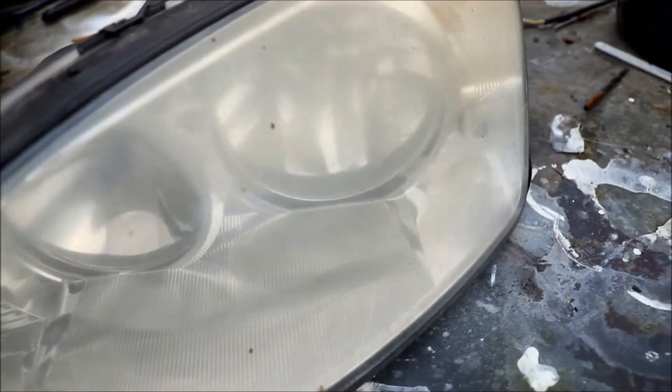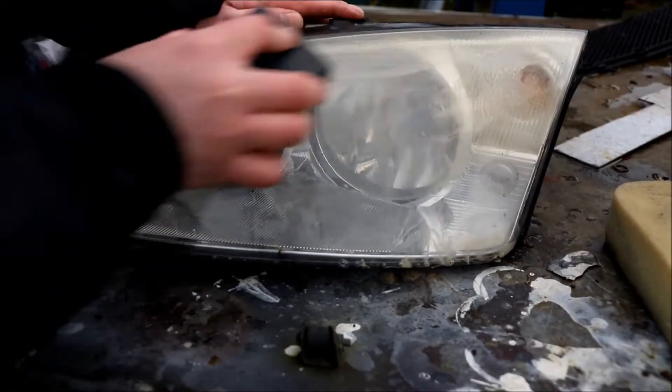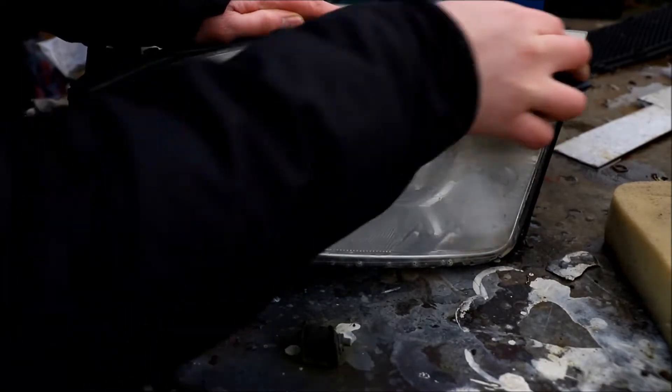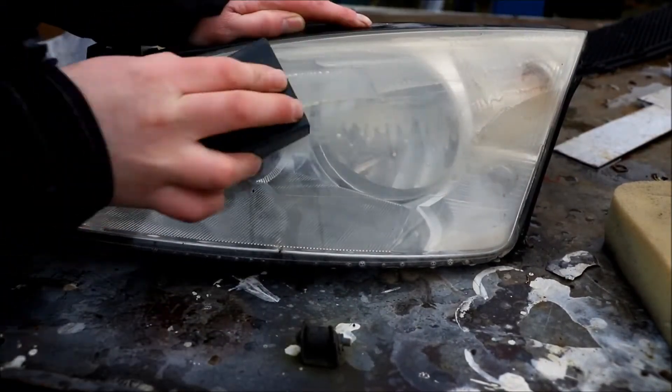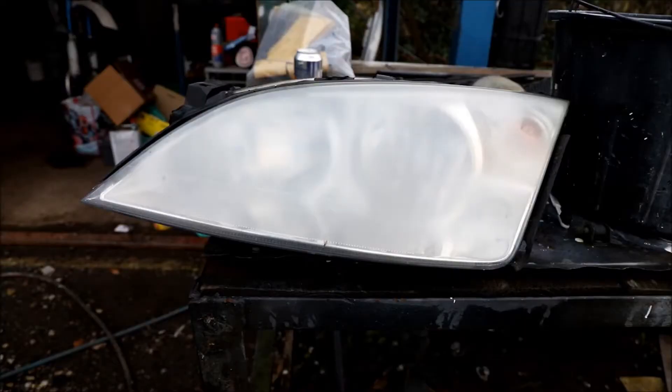The rubber seal is deteriorating — they're not great, but I'm working with what I've got. I've got the 800 grit on a flexible foam pad, just going to keep going in the same direction all the way along. I spent about five minutes with each grit: I used 800, then 1,500, then 2,500, and then 5,000. The 5,000 would have been overkill for definite, but I've got it so I used it. I'm now going to find some plastic polish, give this a polish up with a microfiber cloth, fit the new lamps, repair the backing, and fit it to the car.